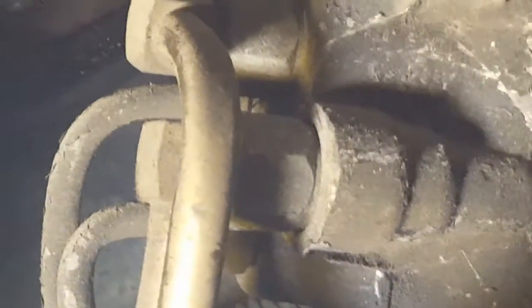It's completely out on the passenger side, just about, and on the driver's side it's all the way out. So it exposed the high pressure line that I have to get loose inside here. Give me more room. So we're going to go on the other side now. So now you see I have more access to that nut right there, and I can turn the wrench a lot more, or I can probably get some grip pliers in there to make sure that I don't strip that, because you really don't want to strip that. And pay attention, because there's going to be a copper washer underneath there as well.